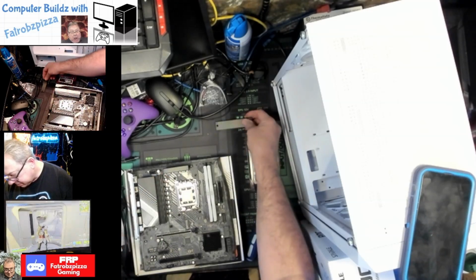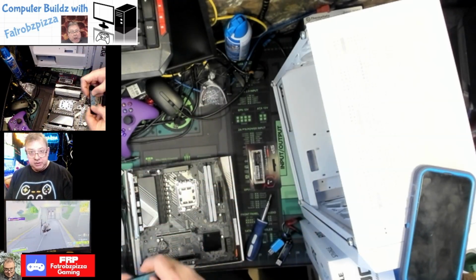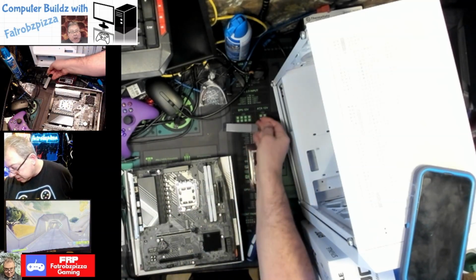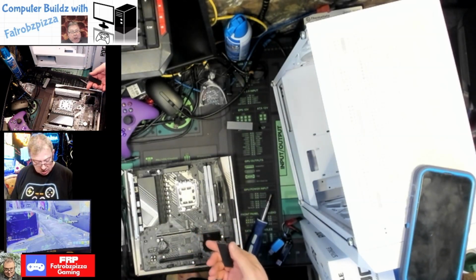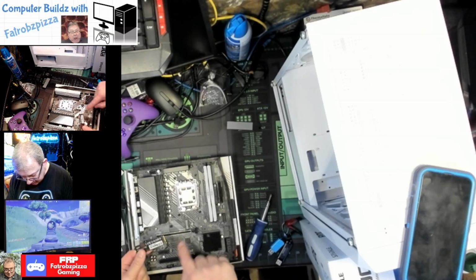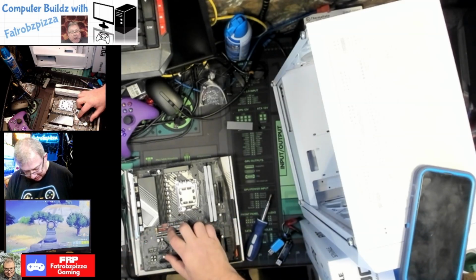Okay. Screw that. Now on the back of this is a heat transfer pad, and we're going to take off this plastic protector because we want that touching the hard drive for sure. Okay, now for the hard drive out here. Now the way this gets installed is here's the slot that it goes into. So this circle thing is going to go right here. Now there's that notch. There's also a notch here to make sure that we line those up. It goes in at an angle around 45 degrees, and then that'll just sit down just like that.